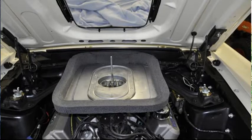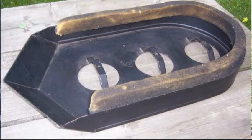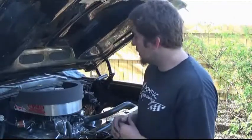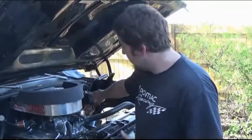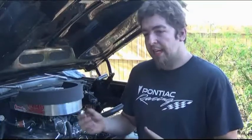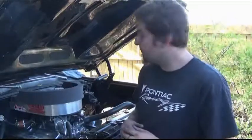Other setups you could probably get away with taking a flat sheet of aluminum, riveting it to the bottom of the air cleaner, and then putting your air pan foam — that's the simplest way. You can get away with that a lot easier on a car than a truck. I welded mine on the inside. If you don't have access to an aluminum welder, what you do is every couple inches add about another inch of material, bend it at 90 degrees, and use that tab to attach it to your flat base. There are multiple ways of doing it; I just went and welded it — a lot quicker, a lot easier.